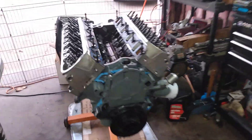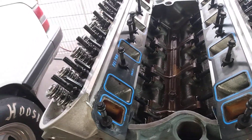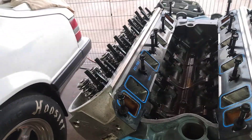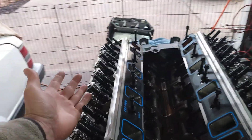We're trying the new cylinder heads and I'll have an update on that January 16th. Now, this is the original 86 that I refreshed with new bearings and cam bearings. It still has my previous shorter-duration Ed Curtis cam. It does have the flat top pistons and I flipped the piston banks like Neo Mustangs does, so you can take advantage of the offset in the pistons. Cylinders one through four are on this side and five through eight are flipped on this side.